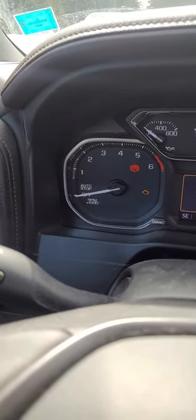Next thing, just wait for everything to go off, just like that. Then you want to press your brake pedal and press your park brake button and hold both of them. You've got the red light, and it's going to start flashing orange — some people say five seconds, some people say ten, but just keep holding it till you get the orange blinking light. Then you release the brake pedal and the park brake at the same time, and then immediately press your park brake. Once that's all done, you're going to have this orange flashing light, which means you can service your brakes.